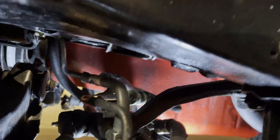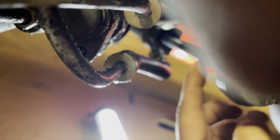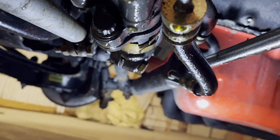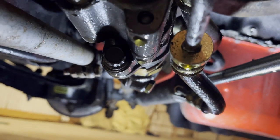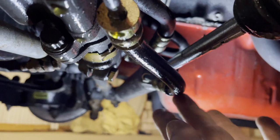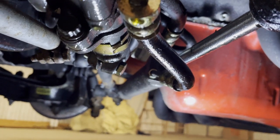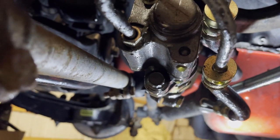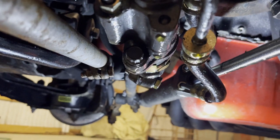And those hoses up here, those will be disconnected from the control valve. So we will not be using this control valve, and will not be using this ram at all. And of course, you can see one of the major problems, even with a brand new steering system, the ram, control valve, all the hoses are pretty much brand new. I've got 600 miles on this car, and it is completely wet under here. They leak when new. So hopefully the Borgeson box will solve that.